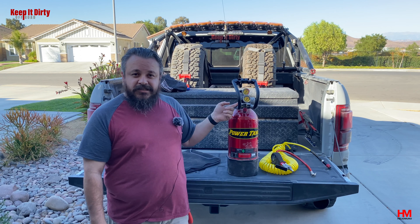This is a 10-pound tank, so we're putting 10 pounds of CO2 in here. Open it up all the way and just let the scale do its magic. Once it gets around 7 pounds, it's going to start having a problem doing itself. That's where a little pump comes in — it uses CO2 from a non-siphon tank to help the liquid CO2 get pushed into the bottle. And we're at 10 pounds.